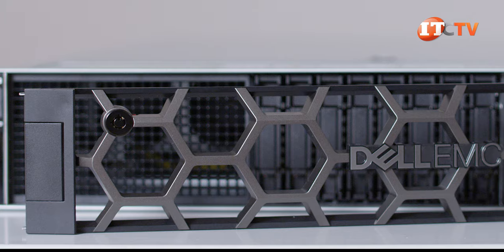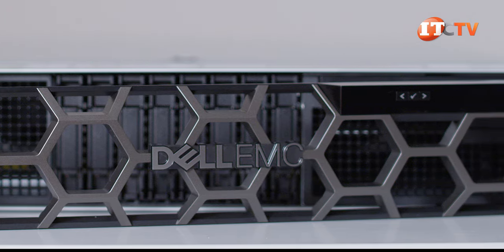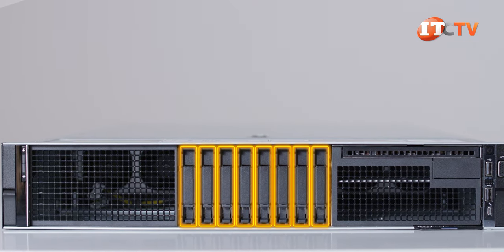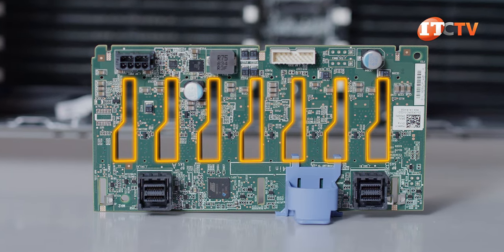You can also go for a hybrid configuration with a mix of SAS and SATA plus up to 12 NVMe drives for 184 terabytes of storage. However, this chassis will only support eight drives up front with the currently installed backplane, for a maximum capacity of 61 terabytes. You will need the 24-bay universal backplane, the SAS expander board, and several ancillary cables to accept 24 drives up front.